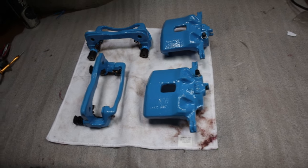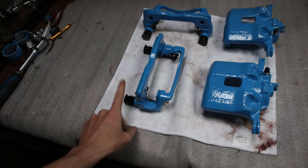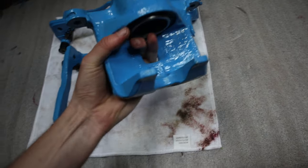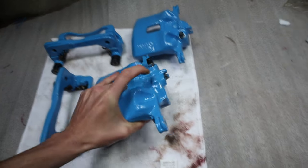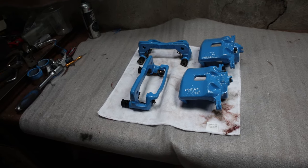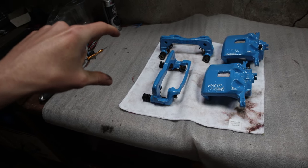That's them all completed, all reassembled, brand new rubber boots, new bleeds, no more rust, brand new pistons and seals, and pretty much ready to go on the car. I'll put them on the car in the next video, because I still have to put on the brake discs.